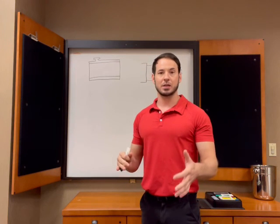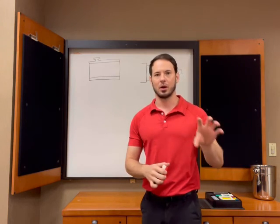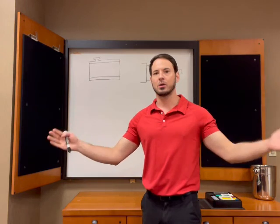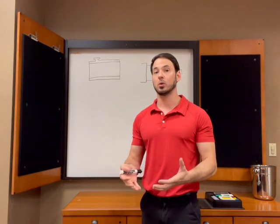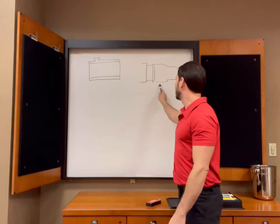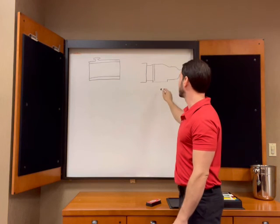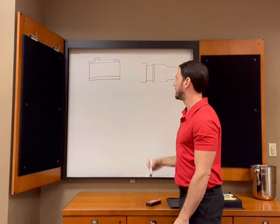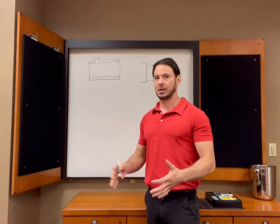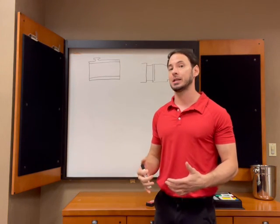Unless we're talking about initial design stages or some other kind of issue, we're not really concerned about what the fluid temperature is right here or over there. We want to know what the temperature is in the pool, and the pool is the pan. That's the transmission pan here at the bottom. Stamped steel pan, aluminum housing here. Of course, we've got our cast pump body there. So having said that, let's talk about what the fluid actually does and how it gets hot.